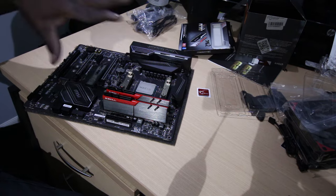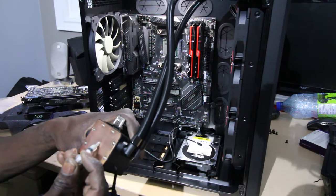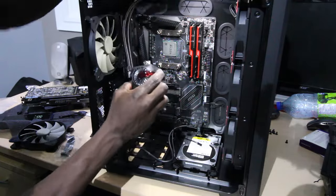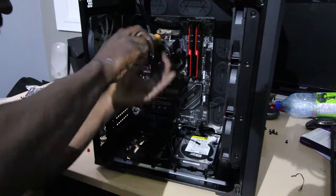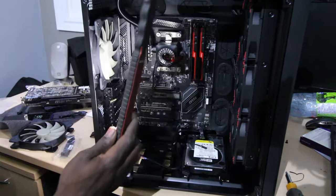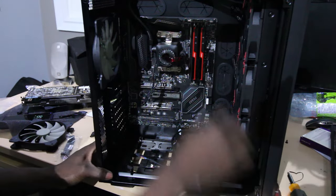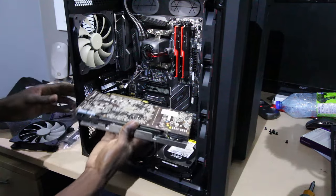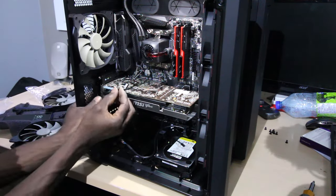I can't put the cooler on until the board is in the case because it'll be awkward moving around. I clean up my desk, put the motherboard in the case, put some thermal paste in the middle, and then here comes the fight getting the water cooler on because of these hoses. There it is — installed. With the fans in place, I should be good. To install the video card, take out two backing plates, slide the card in — it clicks right in — then put the two screws back.